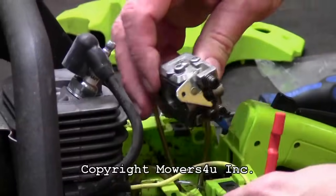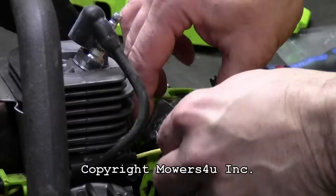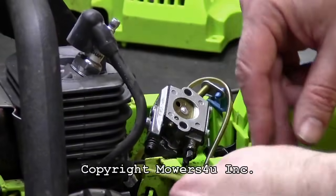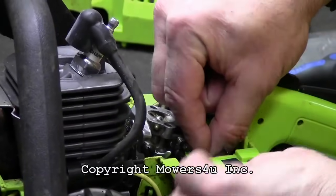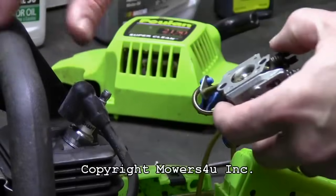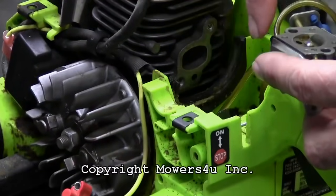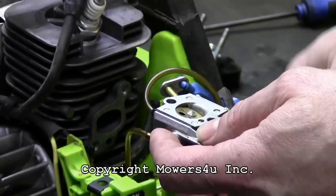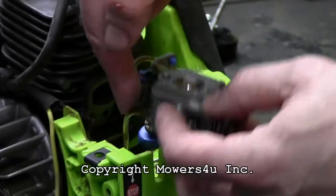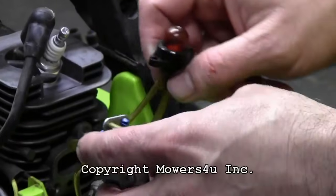Everything here is disconnected. This is our stop switch — remember this line goes on the inside of your throttle rod, not the outside. Now, the smaller line is our supply line, closest to the flywheel, connected to the fuel filter. It comes up out of the carburetor and goes over to our primer bulb. From the primer bulb, a line returns to the tank. So when you push the primer bulb, you're drawing fuel up through that small line, out of the tank, through the carburetor, all the way to the primer bulb, and then the primer bulb returns it to the tank.